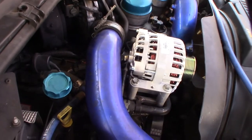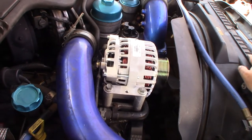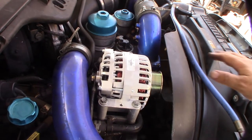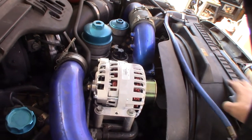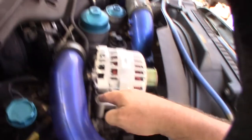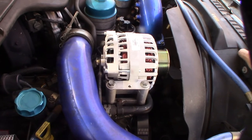If you're wondering — if you have a truck like this and the alternator looks a little different — this is actually a large case upgrade. This alternator should be able to put out more amps. It's the larger case and it's basically a direct swap. I also ground my alternator directly to my battery. There's a spot in the back of the alternator for a ground strap, which helps with radio suppression.